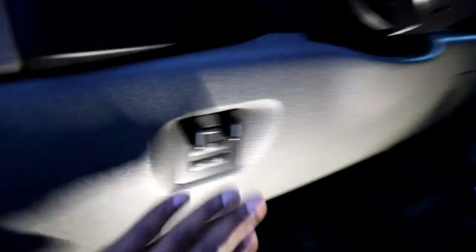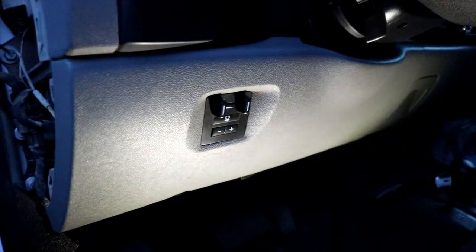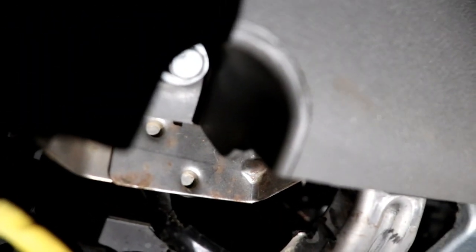This one has wires for your towing, so be careful when you pull on it. On top it has nothing but clips. When I removed those two Phillips screws, I realized there's also a 10 millimeter bolt in this little gap — right there, you can see it. So you've got to pull out that 10 mil too, and I'm pretty sure there's one somewhere else.